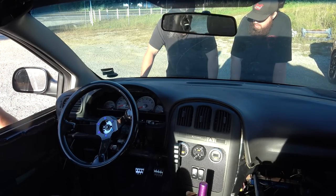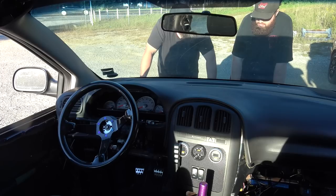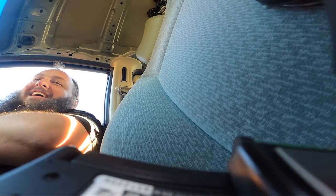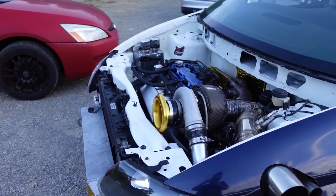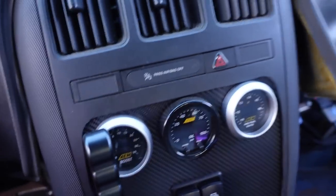What's your timing? We need to get that timing on the plus side — you're only at 30 percent. I bet if I stayed in it it would've left the earth. Peak timing needs to be like 14. Will went ahead and made some timing changes — he brought it down because it was ramping timing back in as the boost went up in the higher RPMs, and I just don't want to play around with that while we're trying to dial it in. Also went ahead and just put the gate straight to the turbo, so hopefully no more boost issues. I'm going to take it back out one more time and see if we can at least get a hit on gate and go from there.